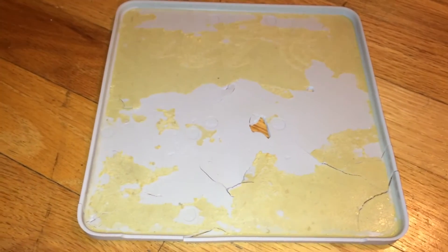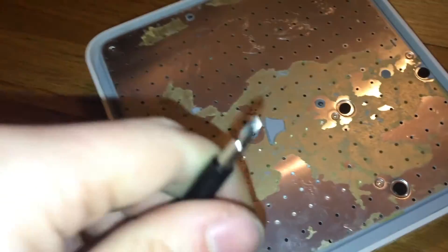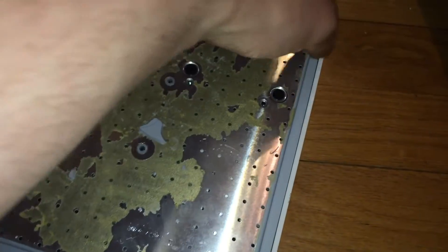Once you get the base off and mostly in one piece, we can now remove all the screws in the bottom, which require a number one Phillips head — every screw you want to remove. Once all the screws are out you can go from the back and lift up. Now there may be wires and other things connected, so you will want to be careful and not pull up instantly. For instance, in the fourth generation you have a cooling fan right here which you will need to disconnect from the logic board. Then you just continue lifting up, making sure everything is clear, and it will come right off.